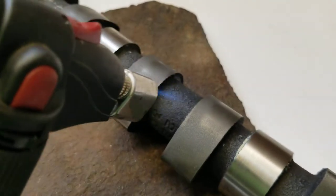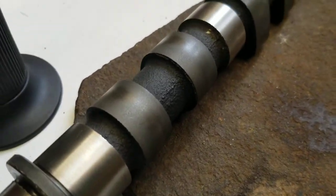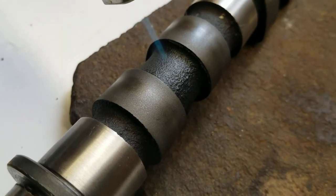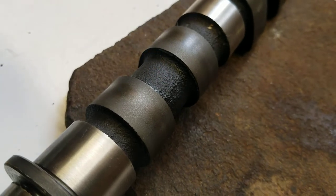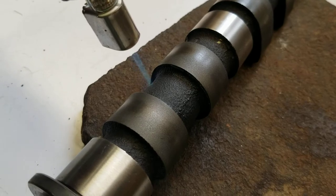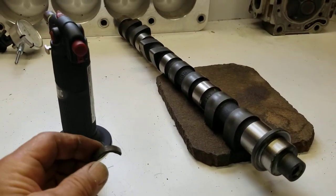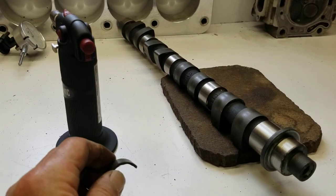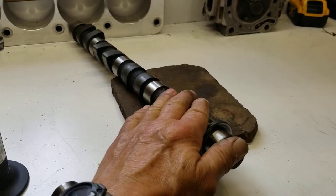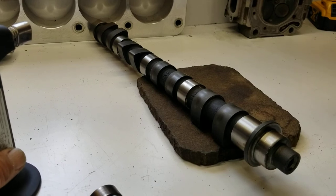Just chasing that over here a little bit - let's do a spot over here. I think the focus was messed up there because of my hand. You see that? It just dries it right out. You can see where it's a little bit shiny on this side and real dull on the other side - that's what we're looking for. You chase that the whole way around and it'll just chase that moisture right out. Once you do that, you can apply your epoxy. If you're going to use JB Weld for an engine repair - like a lawn tractor or a small Briggs motor - go ahead and take the time to just heat it up a little bit. That's all you need. It's just enough heat from the flame to bake out the oil that's in there.